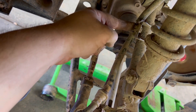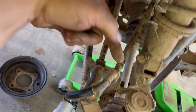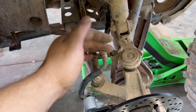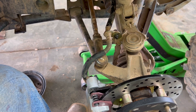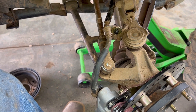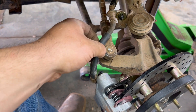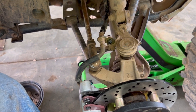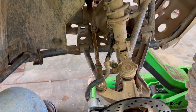What I just want to do is turn this one over to bring it up top here. So simple enough, I'm going to do it and I'll show you what it looks like. Short of just unbolting this and leaving it hang here, this here's the best I've come up with. Straight — it does good. Turned all the way this way — it does good. Turned all the way that way — it does good. It rubs this tie rod just a smidge, but it's got a protective layer over it. I don't think it's going to hurt it. This bike doesn't get used very much at all. So I think we're good to go there. That's the best routing I can come up with.